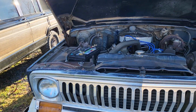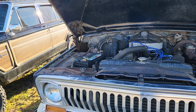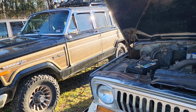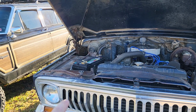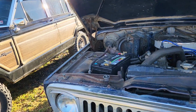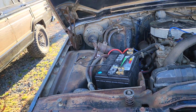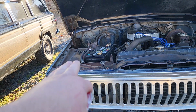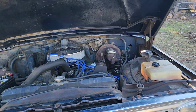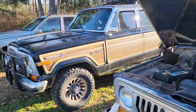If you're new to this type of stuff, very simple. Find your breather tubes, find how high up they go. Every Jeep is different, but for the 3 Jeeps that I have, they're all the same. They're about halfway up. The breather for the engine is about halfway up, usually always behind the headlights. The new Gladiator, I believe the engine breather is on the side right here. So as far as the engine goes, you're safe above the headlight on the new Gladiator. So you can go pretty deep in those things. So anyway, like I said, just a short little video. I just wanted to talk about that.